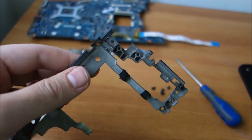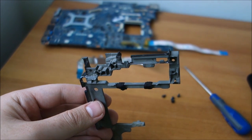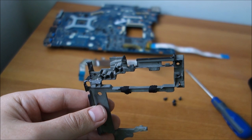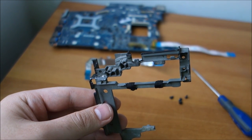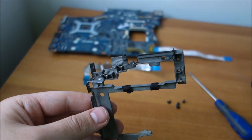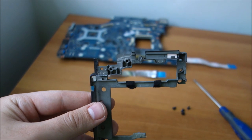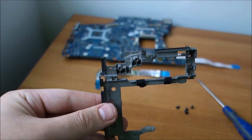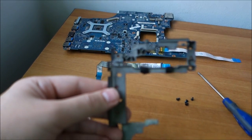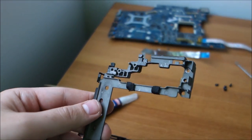And if you've watched my other repair videos, you know what's coming next. I'm going to use some cloth with the water-like type of super glue to make something similar to, I don't know, carbon fiber, something like that. Basically, it is extremely strong when you mix super glue with cloth. The super glue is brittle by itself, but if you put it onto the cloth, it's way stronger. So this is what I'm going to use, but I have to make sure that I don't put that mix somewhere where another thing has to attach to this, because then there is no room. So yeah, I have to be very careful where I can use that mix. But hopefully this will be strong like new.